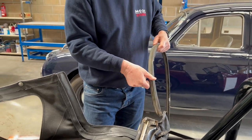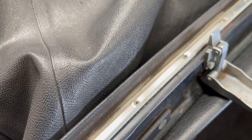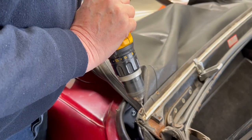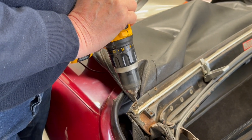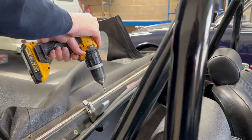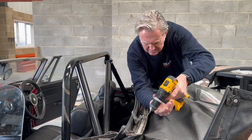What we can see now are the rivets which hold the seal retainer strip in place. These need to be drilled out using a 1/8 inch drill bit, or slightly smaller — sometimes 5/64th is the best one to use. Pop them all out.